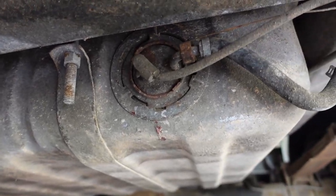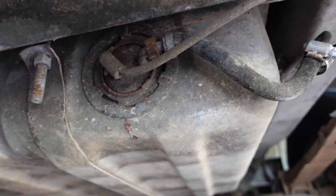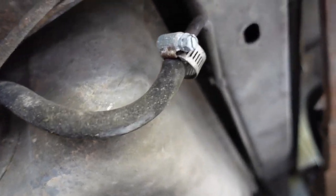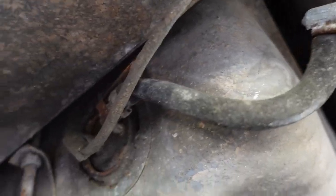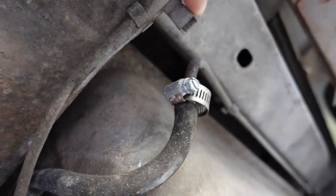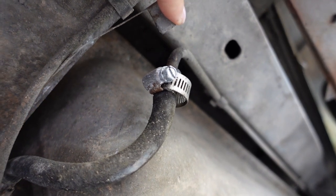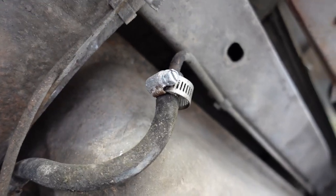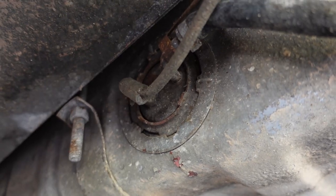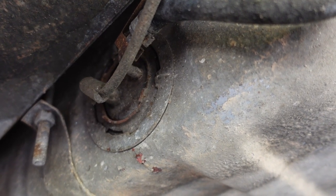The sending unit is on the passenger rear of the tank. Looks like I won't have to jack the vehicle up — it's high enough that I think I can get the tank pulled out if I need to. The rubber hose probably could use replacement. They don't have the ground strap hooked up; that should be clipped to the metal fuel line there, which could be part of the reason why the sending unit is not doing what it needs to do. Let's get a drain pan and pop that lock ring out and take a peek inside the tank.